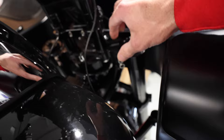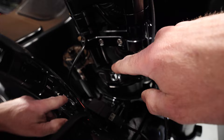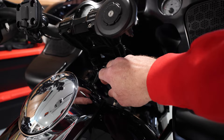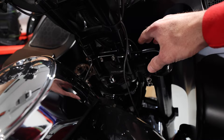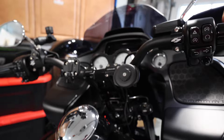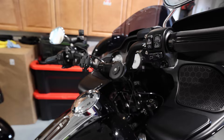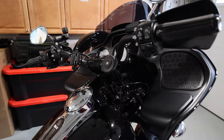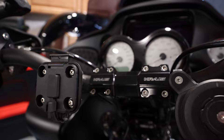Right there is the steering lock — I have a key for it. That actually removed the entire plastic nacelle, all that plastic housing, and the ignition switch. So we have the Kraus triple tree, an 8.5-inch kickback riser, and an ODI bar which is 4 inches. I've got about a 12 to 12.5-inch rise on the bars. The risers are kicked back, the seating position is really super comfortable, and I can also kick the bars back further by loosening the top clamp.